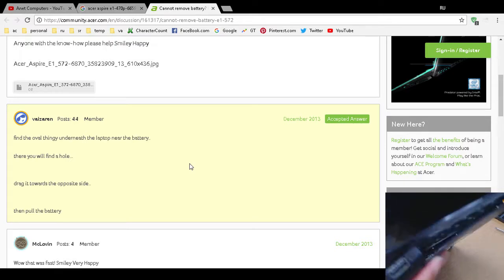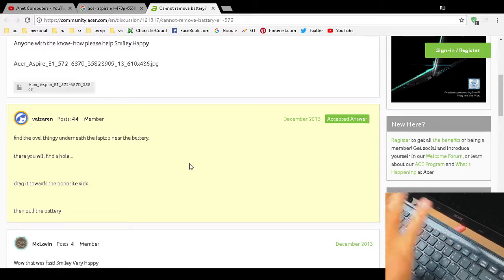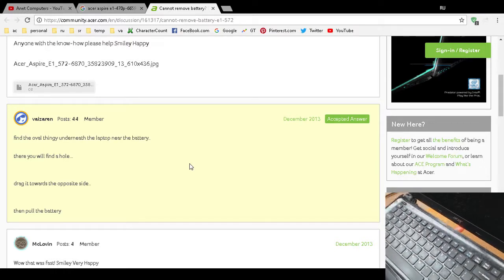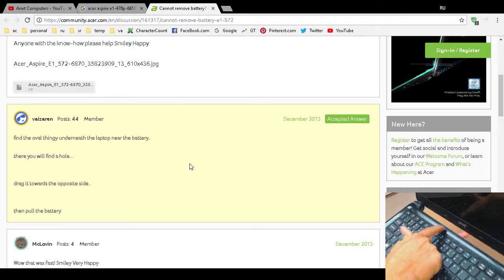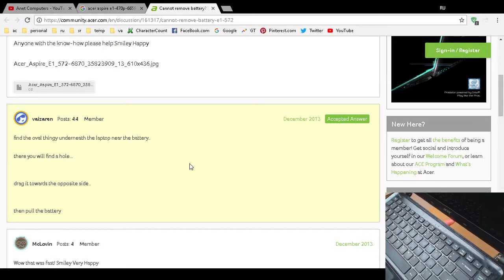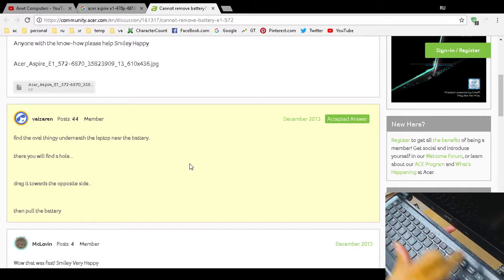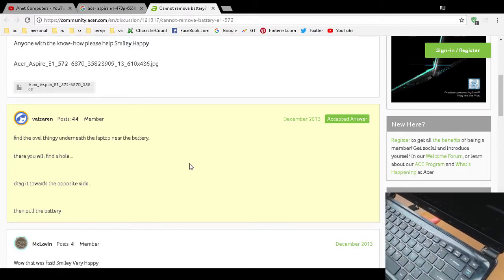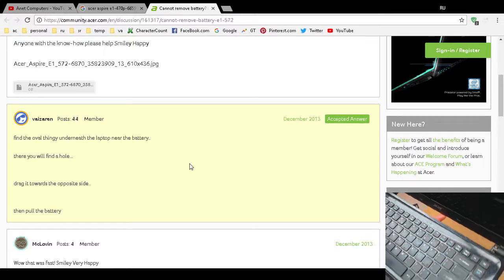There it goes — now I barely even pulled and there we go. That's what you want. Once you remove all the screws it doesn't necessarily mean it comes apart like that — it only came apart that easily because I used the pick to loosen all corners. Except here — I noticed there was a problem, I kept tugging, it wasn't moving, then I figured out the battery release hole, then I saw those two small screws. When I unscrewed them it literally fell apart.